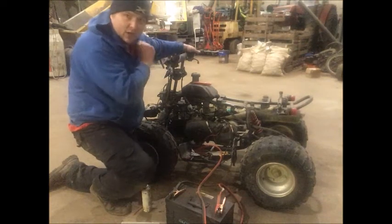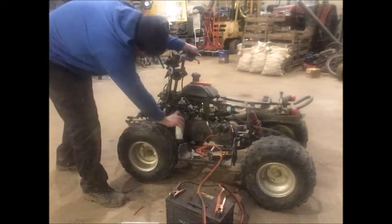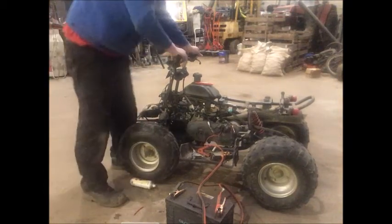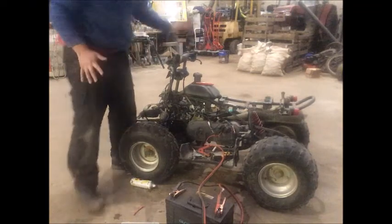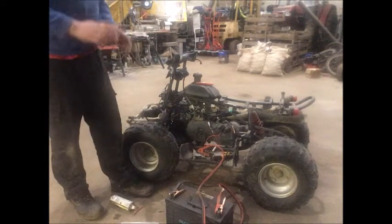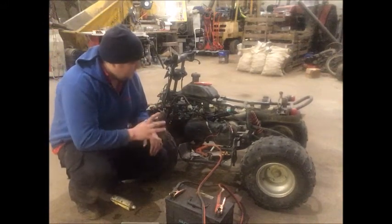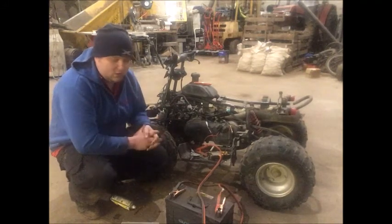We'll have some sort of light. Let's try that again - throttle open, a tiny little job of easy start... okay it's firing up! We know now that we have a spark, we've got light in the system. We can start to tidy up whatever's left, put all the plastics back on, and then figure out our rectifier wiring until we get the battery charging.